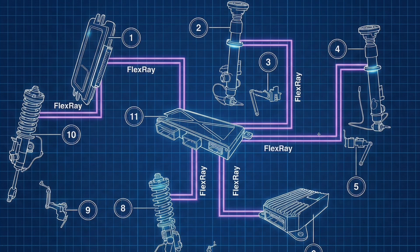Number eight, of course, is the front left, and it's all connected in one sweep. Once that connector is disconnected, we've proven that we've got a line fault if it stops the front damper — number eight — from working. Because they're all connected to each other. There's some internal hardware in the gateway module, and both dampers are physically connected. Once that connector is disconnected, you lose that connection and then you have a signal reflection — that's why we have those faults on the line going to number eight.